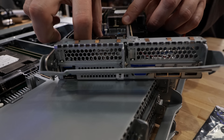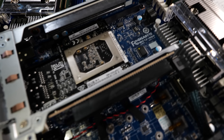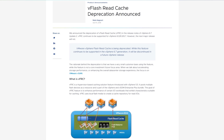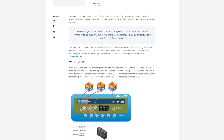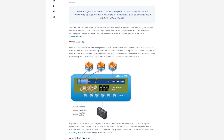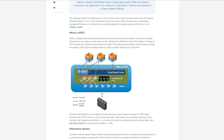It's a little surprising but it is doable and the performance is surprisingly good, as long as you've got plenty of memory to act as a read cache. VMware is doing away with their SSD read caching. There are third-party products you can get that'll do that, so you could run your boot drive and then use an M.2 or U.2 for an SSD cache — basically a read cache for your virtual machines — but that's kind of going the way of the dodo with VMware.